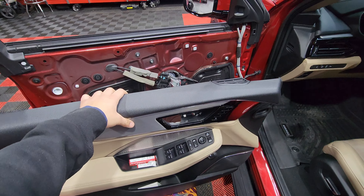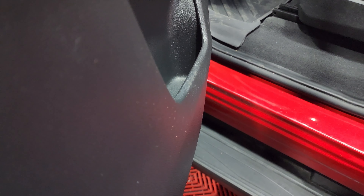Quick warning: the front door panels are a lot easier to take out. The back door panels come out the same way, but there is a bulb down here. You cannot pull the back door panel out the same way as the front because you will break the bulb. There is a plug there. You want to pop it out just a little, put your hand in, push down the clip, and it comes off. It's connected to the door — if you pull it out fully, you will break it. Just a quick warning on the back doors: there is a plug down there that you must remove before taking out the door. The two front ones are easier because they don't have that plug.